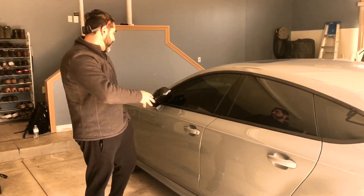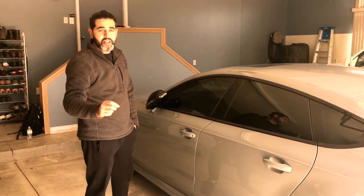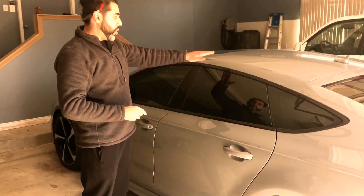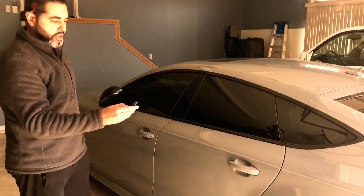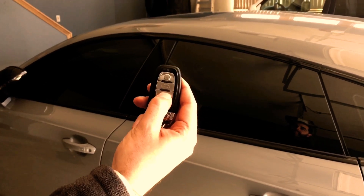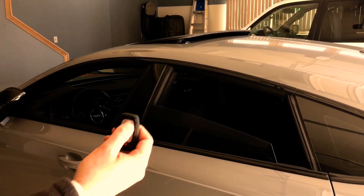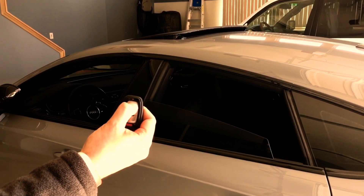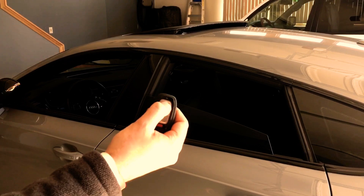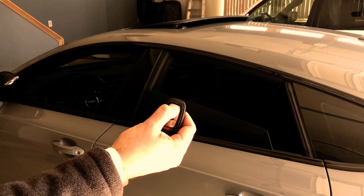So we've done the coding. There are a couple things I still have questions about with OBD11, but what I wanted to show you is how to roll the windows down. We coded it so the windows would go down and go up — but going up is not working. If I unlock the car and hold the unlock button a second time, the windows go down and the sunroof opens. But if I lock it and hold the lock button, it doesn't roll back up — whether I do it two, three, or four times, it just doesn't work.